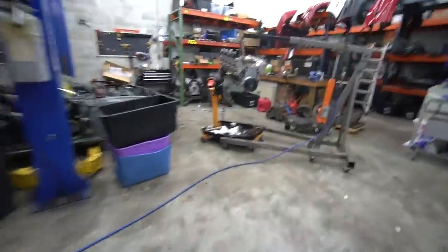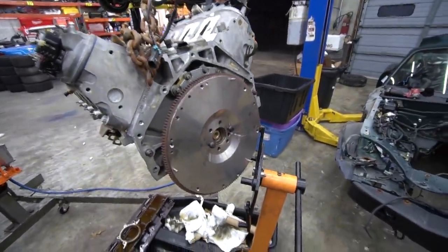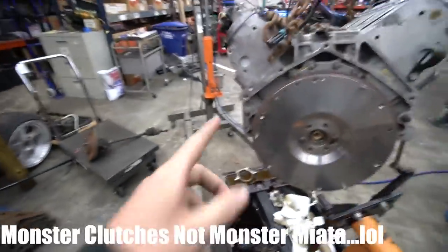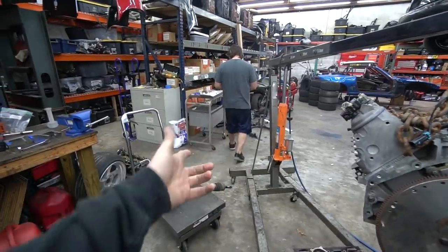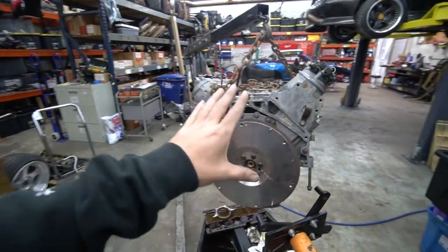Right now he's working on dropping sockets into the pan of oil and getting them covered — it's a method of his called bolt socket lubrication. He got his pilot bearing in, and he's getting his flywheel on. He is also using a Monster Miata clutch, which is what I have in the RX-7. I have kind of a hodgepodge clutch kit — a stock LS1 flywheel and pressure plate, but with a 350Z disc because the 350Z transmission has 350Z splines, even though we're using a T56 bell housing. It doesn't quite fit right — it's a little bit too small in diameter.